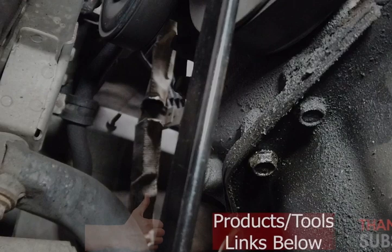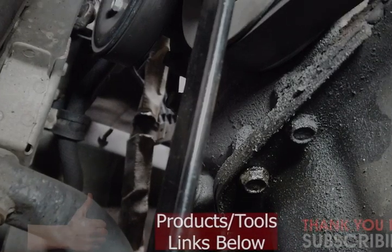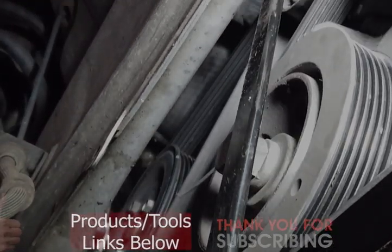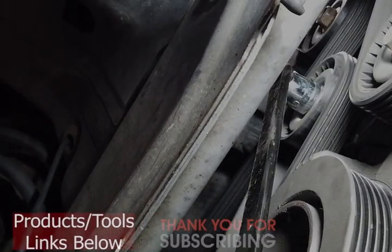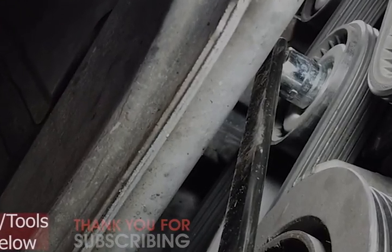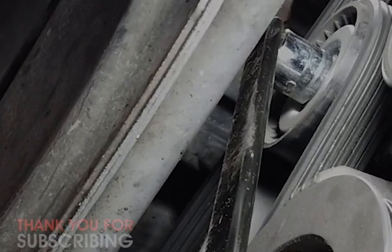What we're looking at here is a serpentine belt tool. It's the black tool that's sitting in front of you, and you watch, it's going to go on up here and connect. It's sitting on top of the actual tensioner. This is the way I would recommend doing it. A lot of people just put a wrench up there. Sure, you can do that, no problem. This just makes it super convenient.